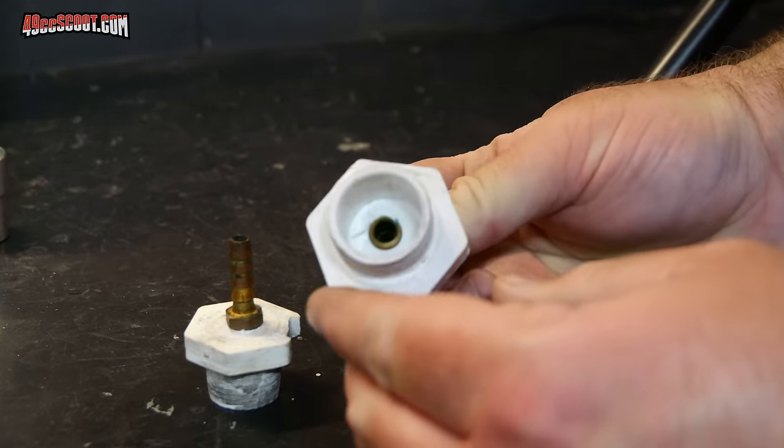I've just checked the two spots that are very common for me to see leaks when I set up my tester if I haven't clamped something right. After that it's kind of a crapshoot. So I just work my way around spraying things with soapy water and looking for air bubbles. I'll spray this crank seal, pump that up — and I'm seeing air bubbles. Definitely got a leak on my crank seal. Let me get you a closer look. I'll spray some more soap and water and pump it up — you can see the air bubbles streaming out of that crank seal. I definitely know I've got a bad crank seal here.